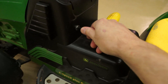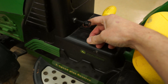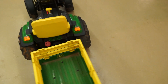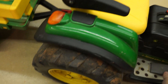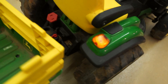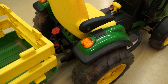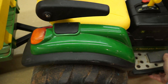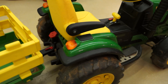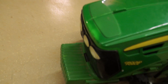I also installed a four-position rotary switch — I need to cut the shaft a little shorter, but here it is. This is used to select different operating modes, very much like what you would have in a car. Everything's off right now, there's no drain on the battery. But if I press the accelerator pedal and let off, you'll see those rear lights turn on — that's actually the brake light feature. Since there's no brake pedal, I decided people behind the vehicle definitely needed to know when it's stopping, so I implemented brake lights. I look for when the motors have stopped turning and then turn on the brake lights for a few seconds. There are also running lights, low beam headlights, and high beam headlights.